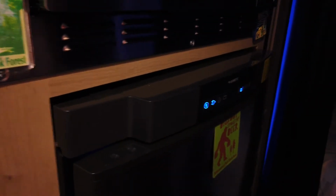The only thing else there is a shower. I wouldn't call it an appliance, but we are planning on changing out the shower head. Basically because like RV mattresses, the shower heads they put in here are not water savers. And you do cut your water pressure down with a regulator when you're at a campground because you don't want to blow out your lines. They make an Oxygenics, which gives you higher pressure and is also a water saver. So that's next on the bill, and probably one of the only things left to do for us that we really want to do. That'll be before spring, or before we go out.